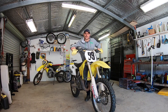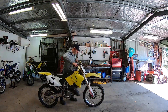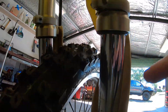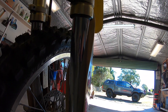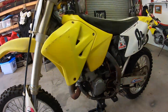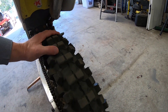Now is a good time to test the front brake by squeezing it and pushing on the forks — you're also testing the forks for any leaks and strange movements. On this bike the fork seals are leaking quite badly on one side and not as bad on the other, but considering the age of the bike, both forks would need a complete rebuild kit. On the positive side, this bike has come with brand new tyres front and rear, which is one less cost to worry about.